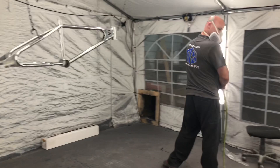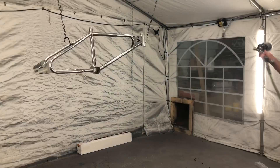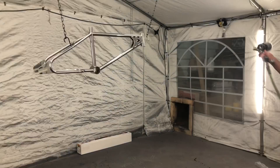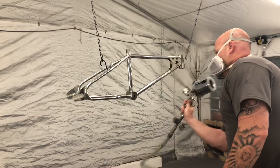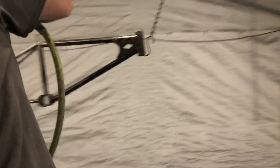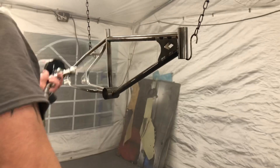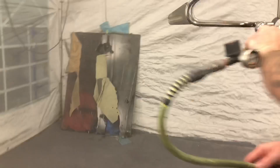Here's Charlie setting up. He's going to spray the first coat, and ultimately there were six coats that went on to the Turbo frame, fork bars, and the crank arms. This is the first coat of black. Ultimately, there will be three coats of black, two coats or maybe one coat of blue, and then two coats of straight clear. In fact, all of this is clear, but the black and the blue are just a tinted clear.